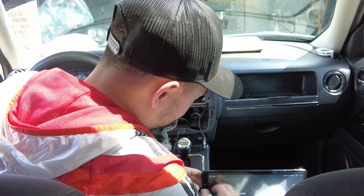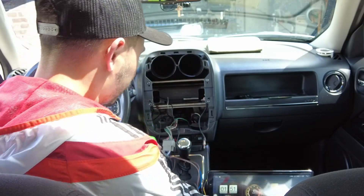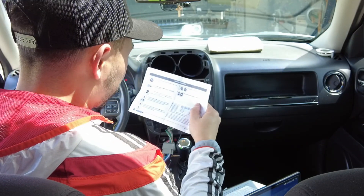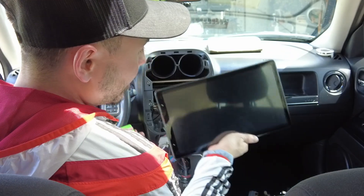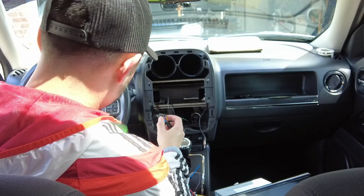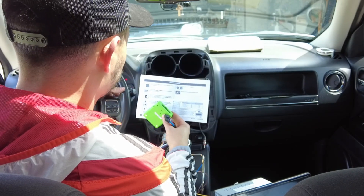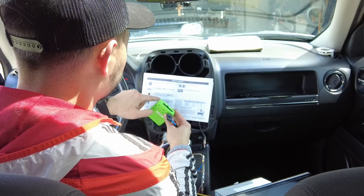The radio does turn on once you plug everything in. There's going to be a light indicator — it's red and flashing right now. We need to restart it because we took too long. Once you unplug the interface the radio goes off, so if you don't get anything on your radio it's because you don't have your interface box connected. Once plugged in, locate the volume up button behind the steering wheel and tap it at a heartbeat pace until the LED stops flashing.